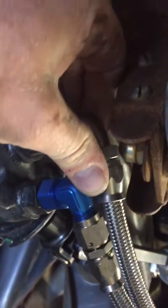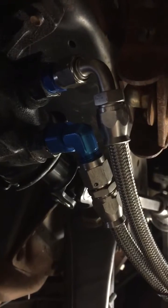All these other ones that don't have that swivel to them — they're tight and you can't move them once you tighten them down. This is the only one I'm concerned with, that guy there. That's the bottom line, it drops down, it's just a return, so I don't know if that's going to be a problem or not. The rest of these guys are just super tight and I'm not too familiar with AN fittings, so I'm not sure if that's going to be an issue. Luckily it's a lower pressure line because it's just a return, but what do you think — is this thing supposed to be tighter? Am I doing something wrong?